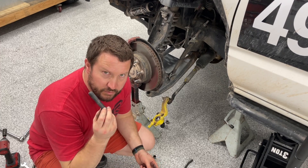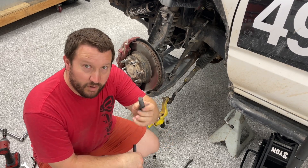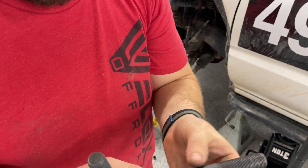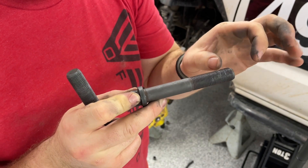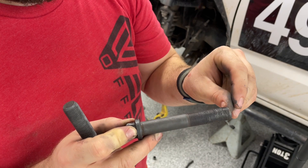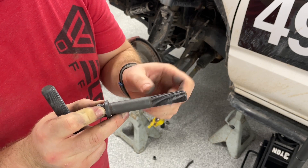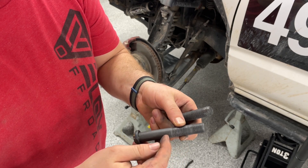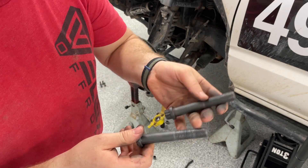However, this is a short-term solution. Using this bolt is a temporary solution because I want it to have a longer shaft. Bolts have a smooth-bore section then a threaded section, and I want to make this longer for two reasons: to have more threads exposed underneath the lock nut — kind of like what we talked about with the rear differential — but also by getting the shaft longer, we can get it long enough to the point where it passes that bend moment failure that I had, and that will reinforce it more.